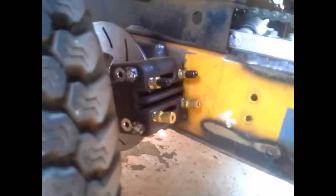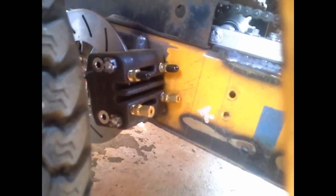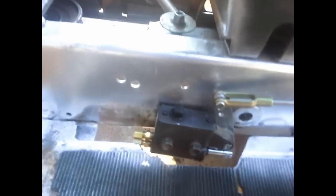It's welded through the frame. Come to the inside and you can see the bolts that come through the caliper. Come to the other side along the front of it — you can see the caliper there, bolted with the disc. That's that assembly there. Hoses will run underneath the frame and come up to the master up here.